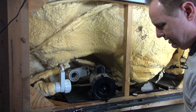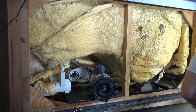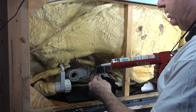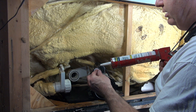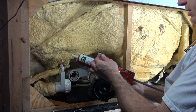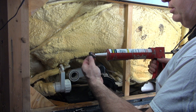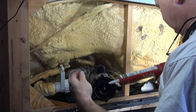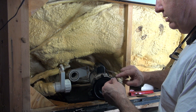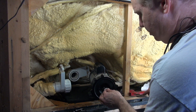There's not too much to do. I'm going to put a little bit of silicone around the edge of my seal — a little bit of silicone right around the edge here. It doesn't take much. Just a tiny bit — just enough to help it slide in, and it'll also lock it in and keep it from twisting on you. Rub it around, and make sure you don't get any silicone on the ceramic surface.